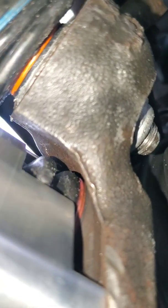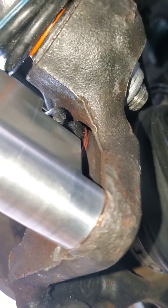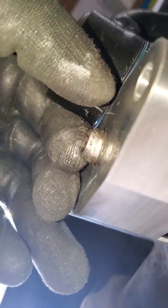You can also see there's a cutout right back here so that the adapter sits all around the ball joint. What we're gonna do is use the ball joint nut, tighten it down here, continue tightening it, and hopefully it should pull out this ball joint from its mounting location. I'm just gonna pause the video, put the old ball joint nut on here and tighten it.